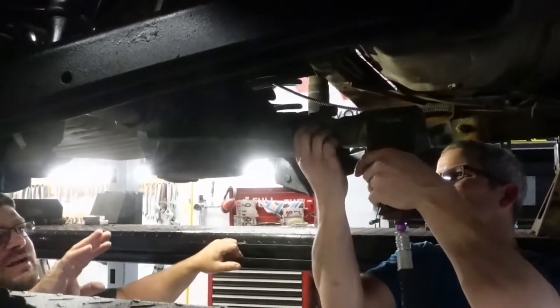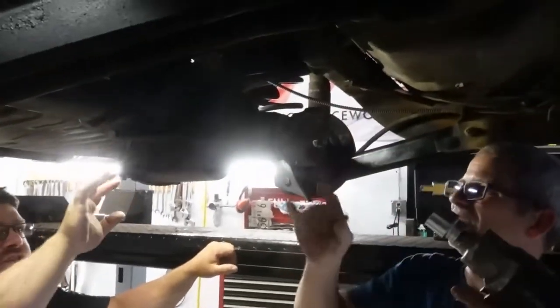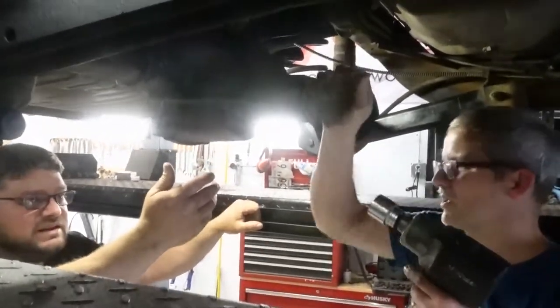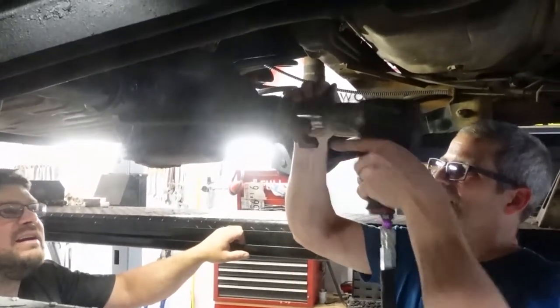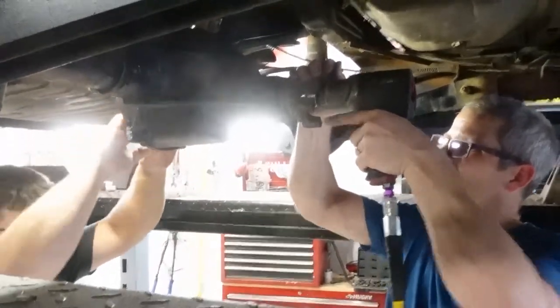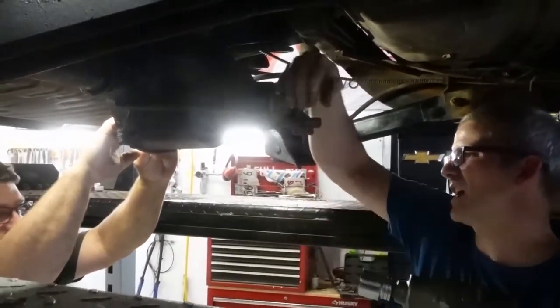So with just the stock shim you pulled off, you just bring it in without a crush sleeve, without a seal. Without a seal, right. And then you just bring it in so you feel it about where it needs to be. Yeah, it's still a little bit loose. Okay. And then you'll put this carrier in and run a pattern. Right. And see what it looks like, and then you can make your feel that drag right there.